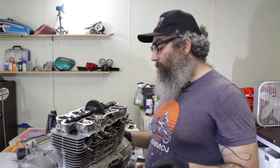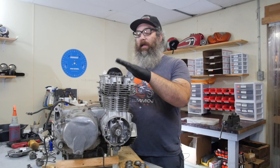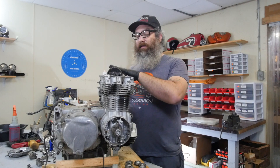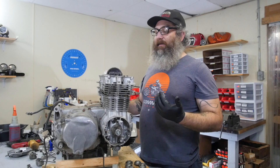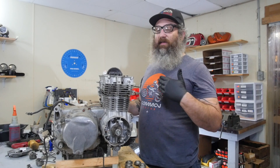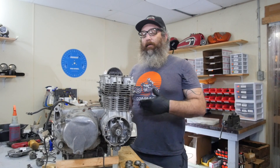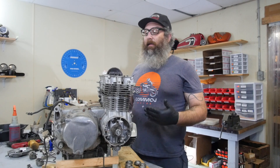We're going to put some fresh oil in there and start putting this back together. Overall, everything looks like it's in great shape. This would be an opportunity if your camshaft or rockers were torn up to take it out and have it serviced. The valve train — meaning the cam, the rockers, the cam chain, all the stuff up here on the top of the engine — is the weakest part of all the Honda engines. It gets the oil last, so when you have a weak part getting lubrication last in the sequence, it's not good.